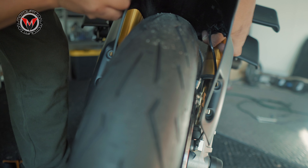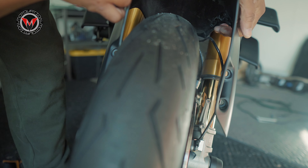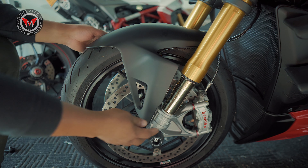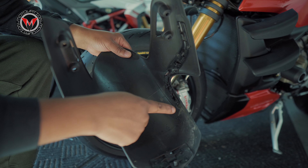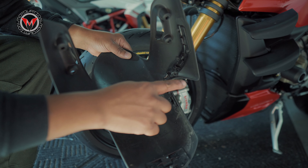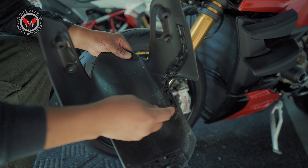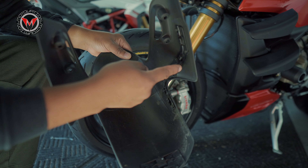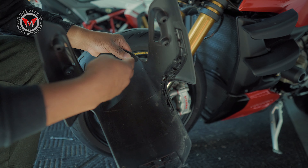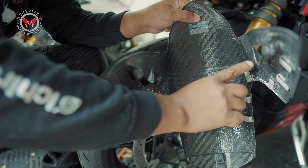Some are facing out, some of them are facing in. Just like that, your OEM fender is off. See? This is where the wire was running — some of them are hooking outwards, some of them are hooking inwards, just to anchor the cable. Make sure you go slowly, because the first two are all going out, and then from there you have two that are going in. Use your hands to kind of follow the groove because it's into the inside of the fender.